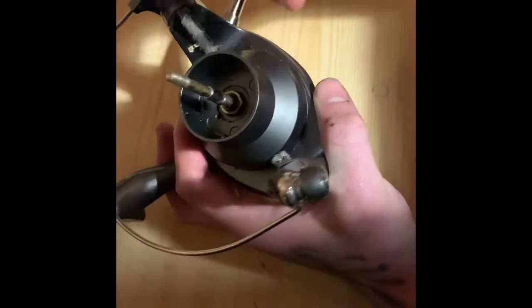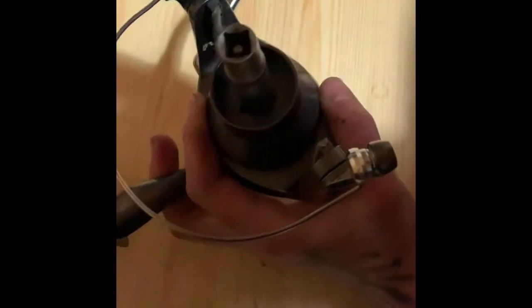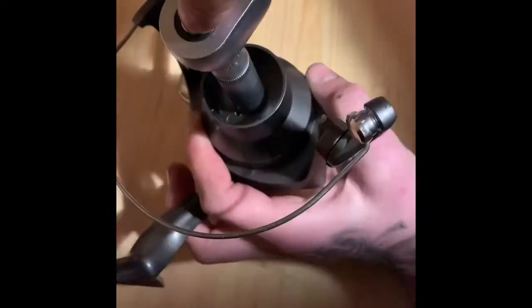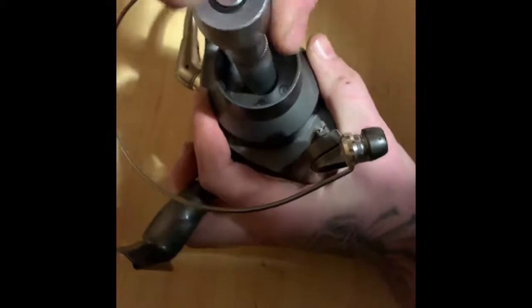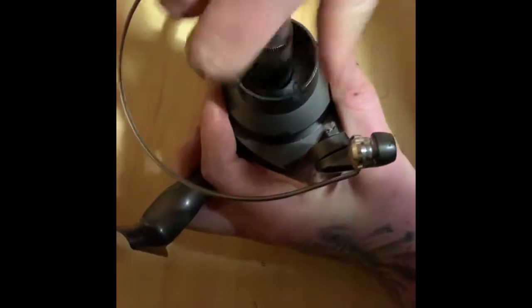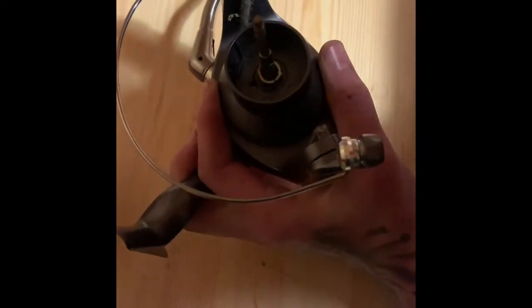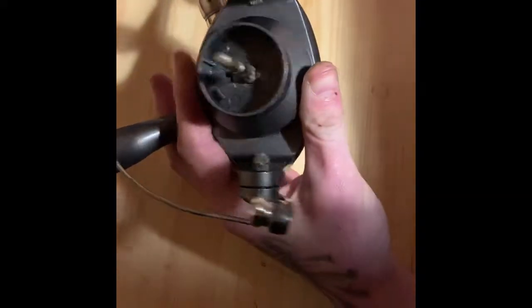I've got deep sockets, so I know it's going to be down the barrel. That's it. So it's a 12mm socket. Let's just undo that. Oh, that's tightening it. Oh, so these are actually the opposite way. So you tighten it to loosen it off, which is quite weird, really. It's not a common thing. Normally you'd say lefty loosey, but that one's the opposite way. So if you're ever doing your own, just remember that the nut loosens the opposite way. Doesn't look like anything else is in there, so let's see if we can, yeah, that pulls straight off. So that's it.